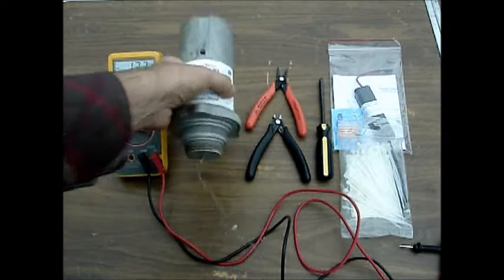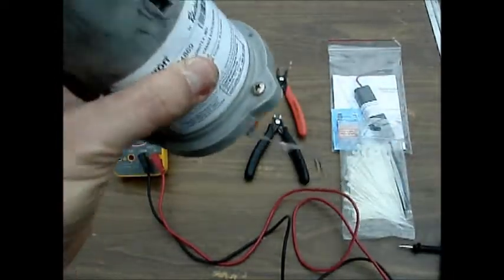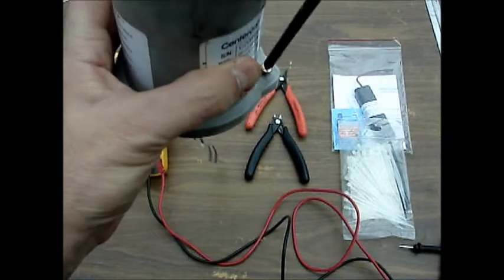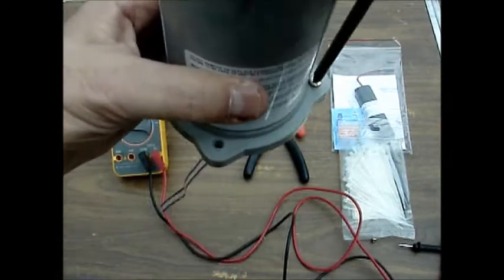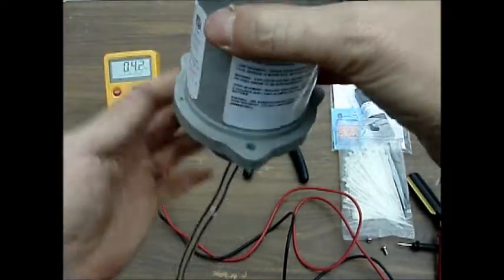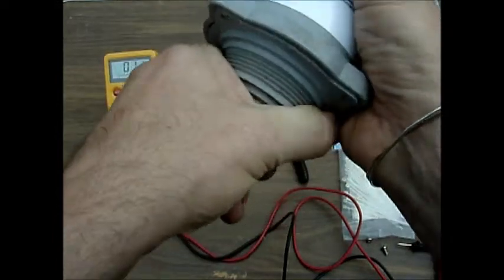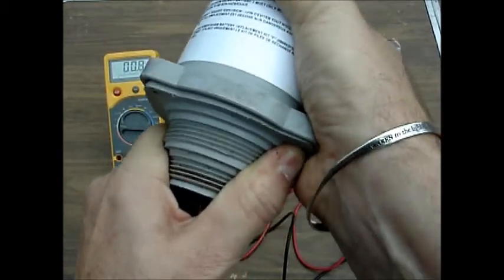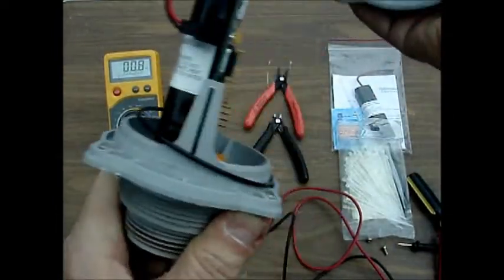In order to change the battery, after you have removed the monitor from your tank, locate the 3 screws at the base and simply remove them carefully, making sure that you keep them. When you have removed the screws, grasp it firmly by the base and the top and apply a slight rocking motion to it and carefully separate the base from the top.